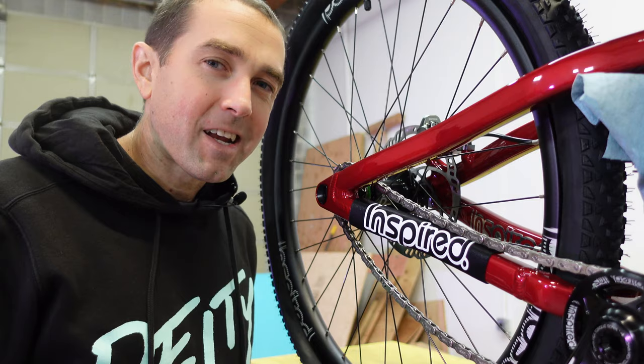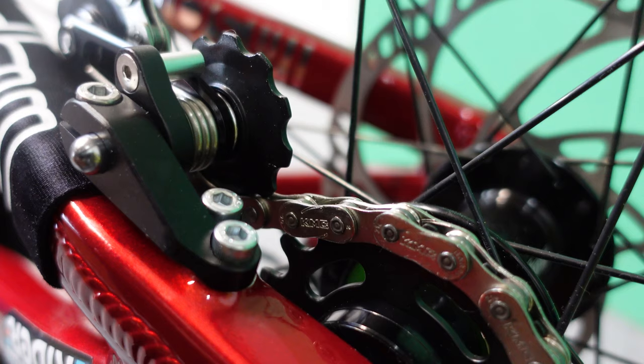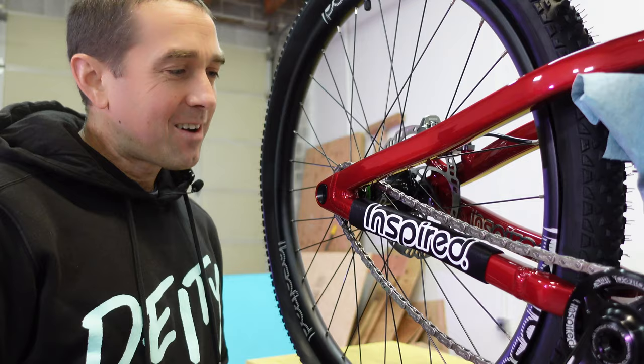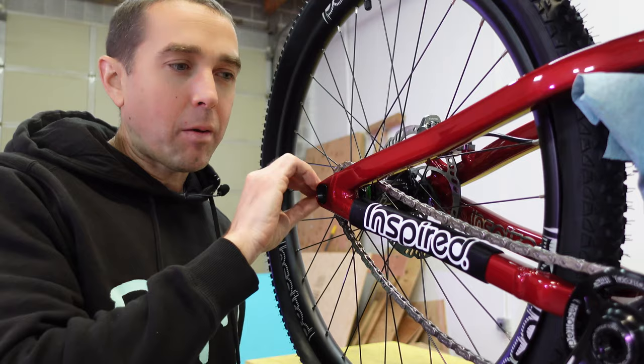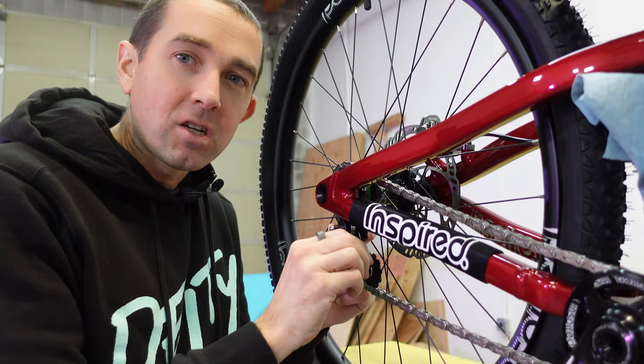One question I get is how I tighten my chain on the bike. There's a piece called a chain tensioner which bolts onto the bottom of the frame — there are two holes right here that the mounting hardware works with. The reason we need it on this bike is that it doesn't have horizontal dropouts. A lot of other single-speed bikes let you slide the wheel forward and backward to tension the chain, but for a bike with a through axle where the wheel isn't going to move, you need a chain tensioner. It just bolts onto the frame with a small spring that puts extra tension on the chain.